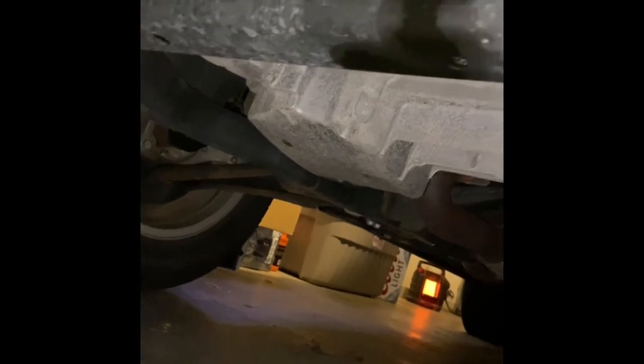I'm going to put the jack right here at the center of the car — that gives me a decent amount of room and I can get the jack higher. I can also get a jack on the same side so it'll be even, which is a bit safer. Also, very important — I know I've got it chalked in the rear, but an extra safety measure is to engage your emergency brake. That'll keep at least one wheel locked so the car doesn't roll while it's jacked up.